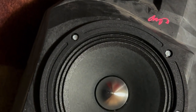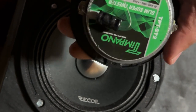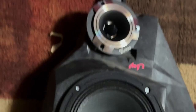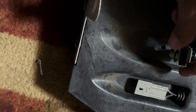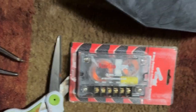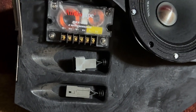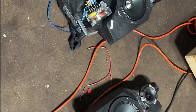The good thing about this enclosure is it tells you which terminal is for the woofer and which is for the tweeter. I'm going to mount a spade connector on the other side of this capacitor. I only needed one - it's in there and it's not going anywhere. I need to hack this up somehow to get my connections going to my crossover network. Now I'm just going to mount this right on here - let me mark this up and drill these holes.